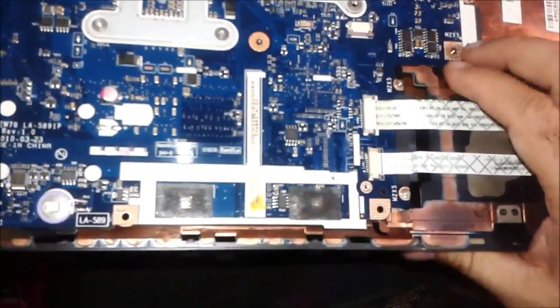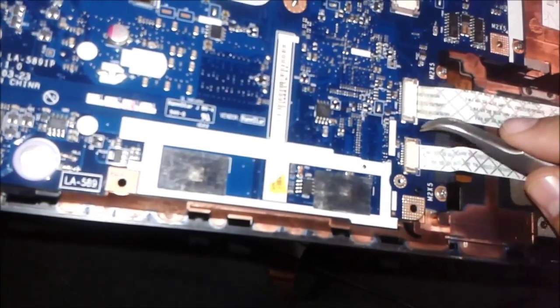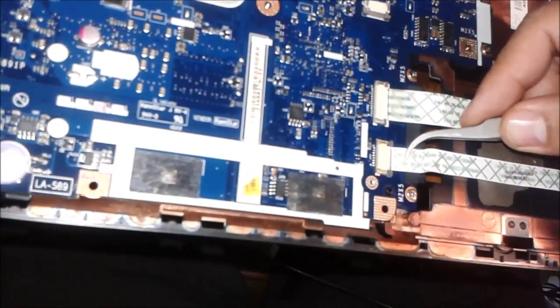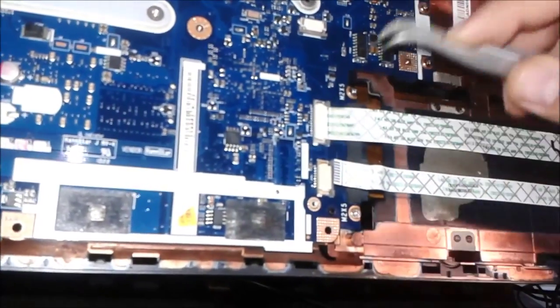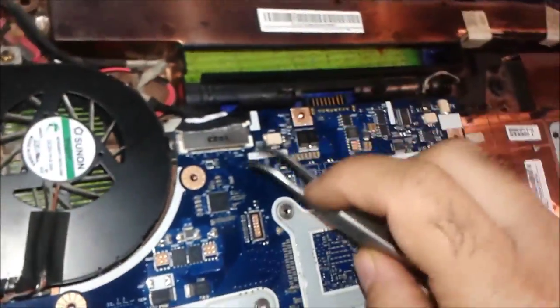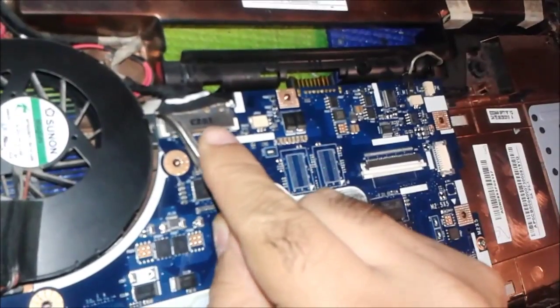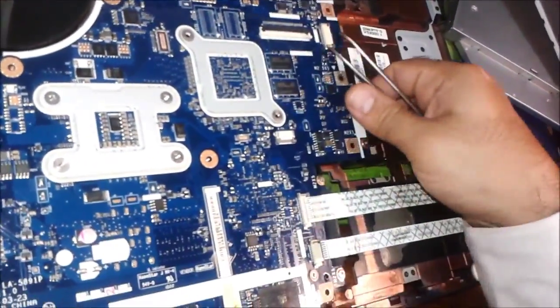This is the cable jack with the motherboard — now we have to remove it. We want to remove the motherboard, so we need to remove all cables connected to it and any screws on the motherboard going to the bottom casing. This first cable — pull in the side, not pull up, so the cable can come out. The second jack also the same way — hold up a little bit, not too hard. For the screen cable, pull from one side a little bit, then pull the second side, and the cable comes out without damage.